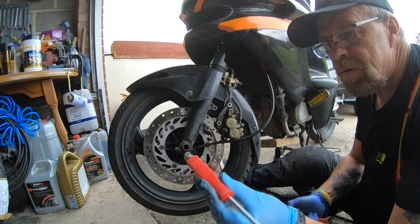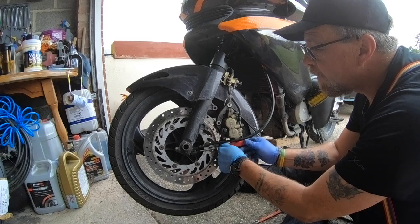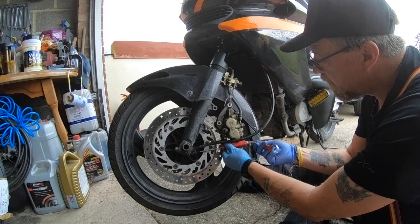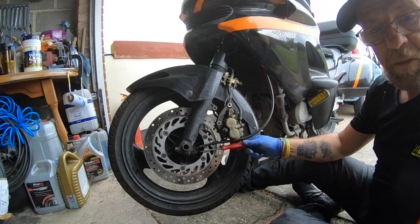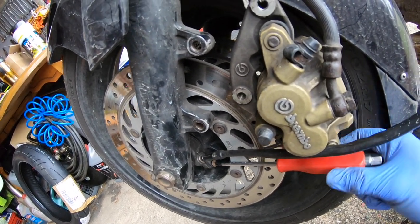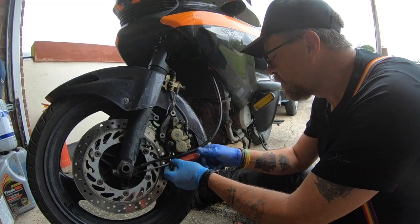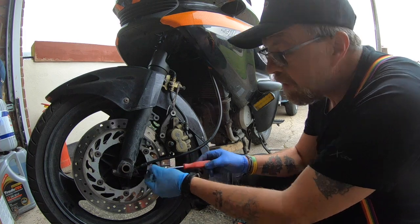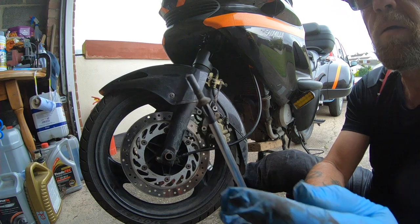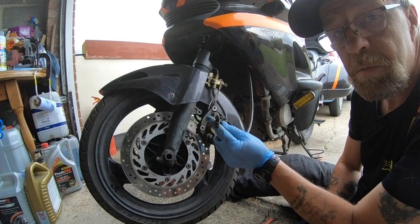So what we had was a screwdriver, guys, that we can put a spanner on. Because I didn't have enough angle, I just managed to get it like that, look, see? So as you can see here, guys, sorry about the weird angle, it's just a little screw just there, look. I could have moved the caliper out the way a little bit more, to be honest, guys. Right, there's your little screw that comes out of it, just like so, as you can see. Now this should just pull out, look, there's your speedo drive.